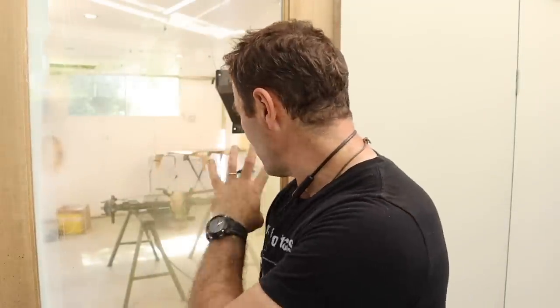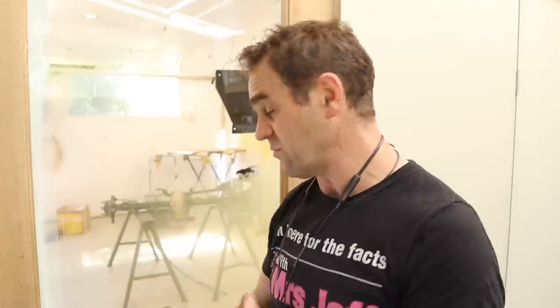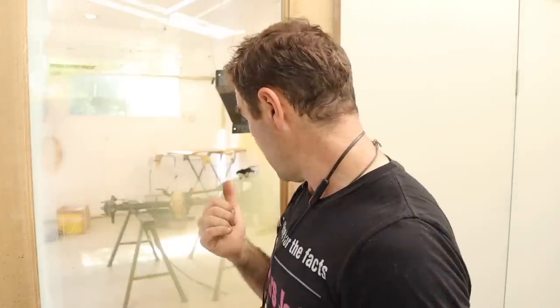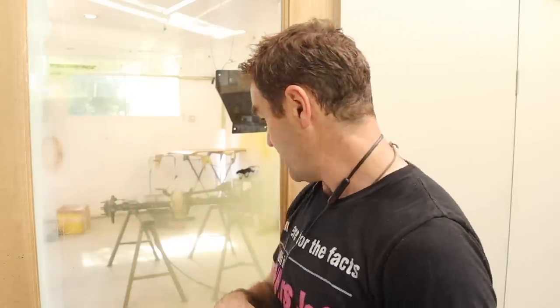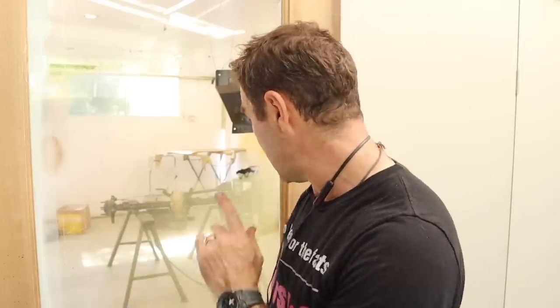Well, the rear end is done. I pulled out one of the axles, I checked the bearings, everything feels good, so I'm just running with it. There's plenty of tread on the brake drum shoes, so they're good. I do have new discs and other things for them. As far as the diff goes, it's all looking good. Nothing was leaking. It's all running well. So I can deal with that maintenance-wise as it comes up. But at this stage, I'm happy to run it as it is. Getting a few bits and pieces like a new handbrake cable and stuff like that. But it's all looking good.